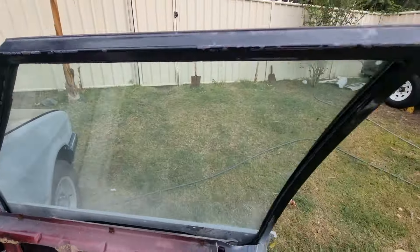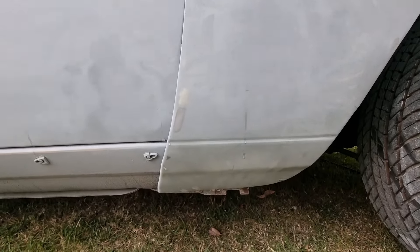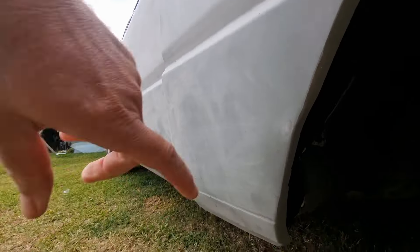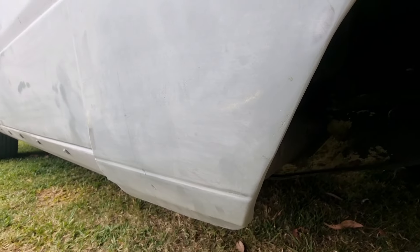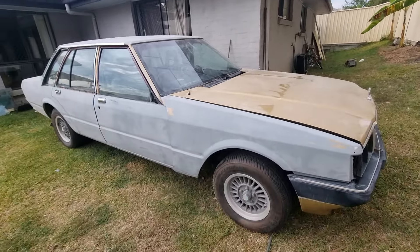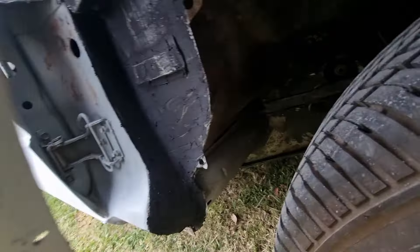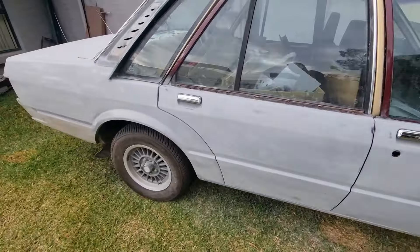The doors are getting painted, slowly. This guard — it's all repaired. That's a rare spares rust panel cut. The joint is here — just here, you can see. I haven't bolted this one, just welded. And that's just high build on that one, needs a lot more sanding. That area was all rusted out, all plated. Now that guard won't sit back on. That was all plated. Body deadener. So yeah, that's the update on the ZJ.